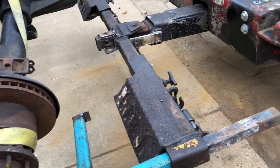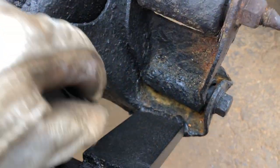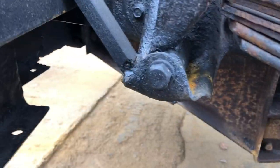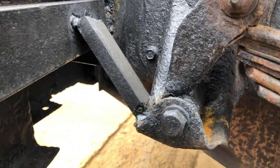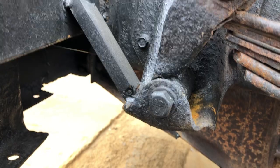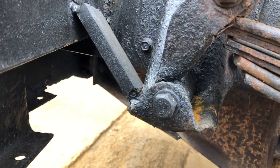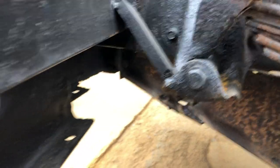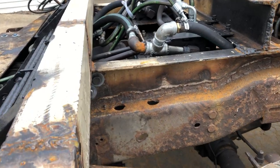One reason Ford trucks had trouble with spring hangers and whatnot rusting out in the rust belt — Ford designed this one to hold water. Look at my rear frame rail, there's three-quarters of an inch of water sitting in it. Next time I have the torch going I'm just gonna blow a little tiny hole in there, maybe three-eighths of an inch, to let the water drain out. I've already blown it out and I'm gonna try to reach in and clean it with a scaler and undercoat the crap out of it. Some of this stuff was just designed to fail.